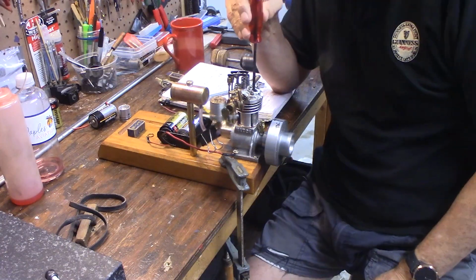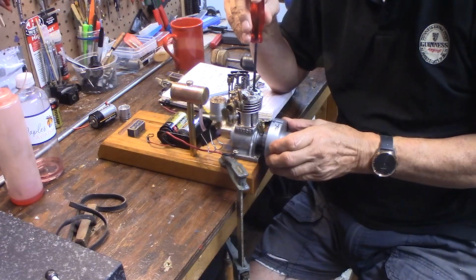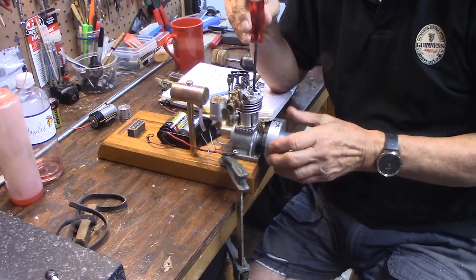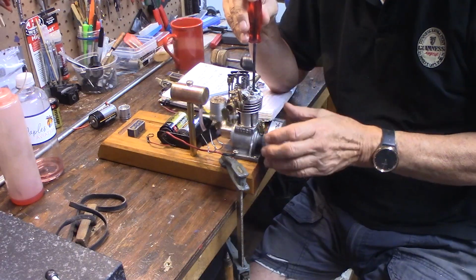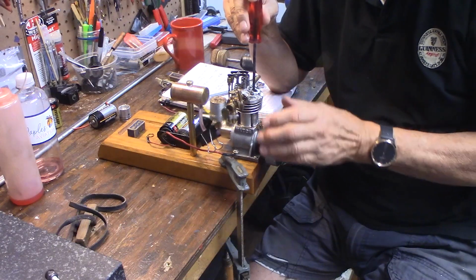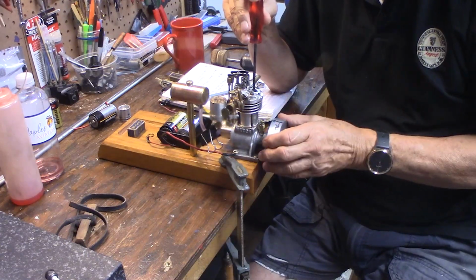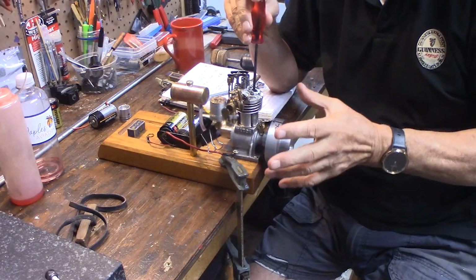You're going to see setups where they suggest that you set the spark to fire before top dead center, like 5 degrees, 10 degrees, depending on the particular engine. Auto manufacturers in the car maintenance manual, they set this up. It might be a lot more or less than this. But for an old model engine that doesn't have spark advance or anything like that, just to get it started, relatively low RPM, you can set it to fire right at top dead center and it will run.